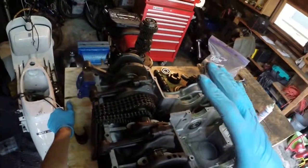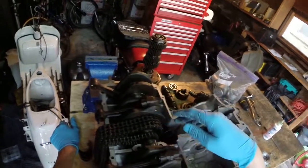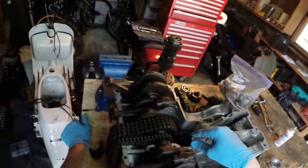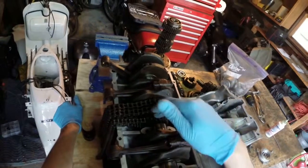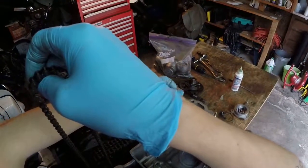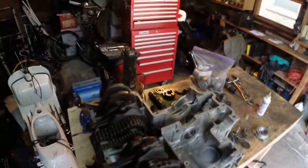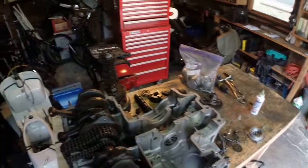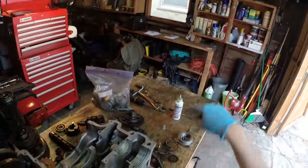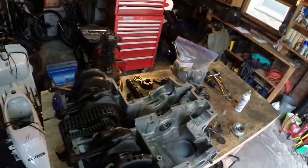Okay, I think we've finished this piece. The only thing that's important here is I've moved the chains to the outside. There are two primary chains. You can actually measure by putting a caliper in the bottom and measuring how tight the tensioner is to see whether they're in spec — I think the distance is like 60 or 70 millimeters, and it is in spec. We've also got a cam chain here which goes up through the engine like this. These are going to spin the transmission and end up spinning the main drive, and this spins the cam. Next we're going to put together the main drive — it's a sprocket that runs a chain back to the rear wheel — and then also install the kickstarter, which is actually a pretty difficult install.